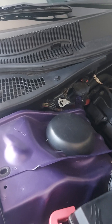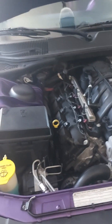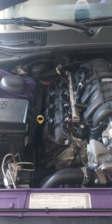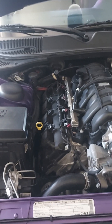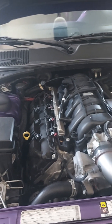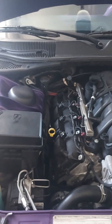If you do some research, you'll find that the voltage regulator is built into the PCM in these Dodge vehicles after 1996. So either you change the alternator and send the ECM out to get it fixed — which is about 300 bucks, or maybe 250 at the lowest — but a lot of people are saying it didn't even fix their problem. So the only other alternative is to put an external regulator in.